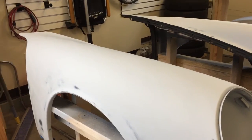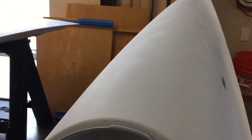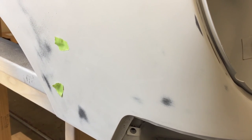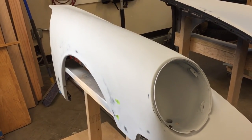It's great for bringing things into shape, but it just doesn't like bare metal. This fender here is really taking shape nicely, but I just need to tune up a couple of areas. I'll put a little bit of build on here and a little bit there — one or two more quick coats in those areas. Let it dry for a couple of weeks, re-block it, and if it all works out, I'm going to shoot this entire fender its last go-around before we do wet sanding.